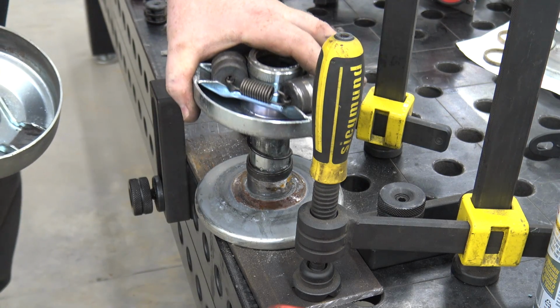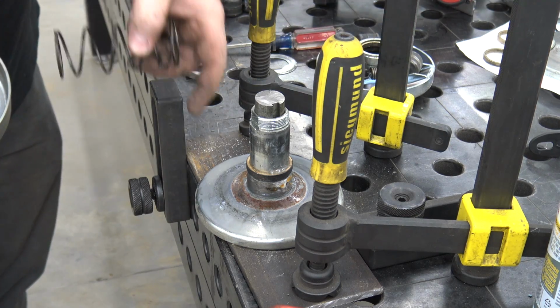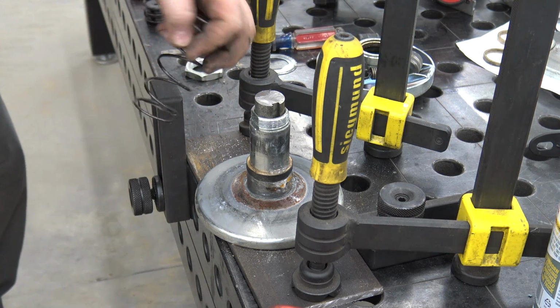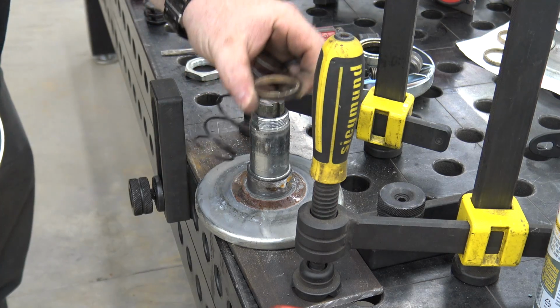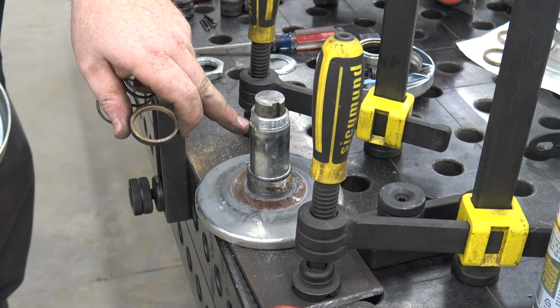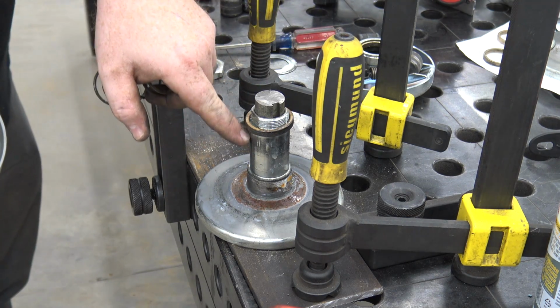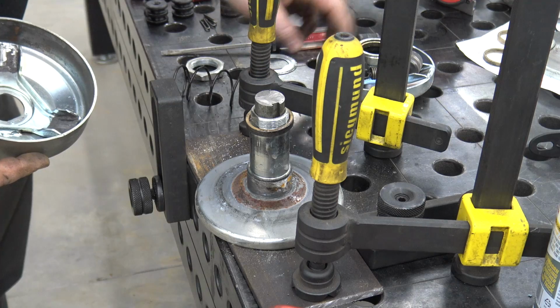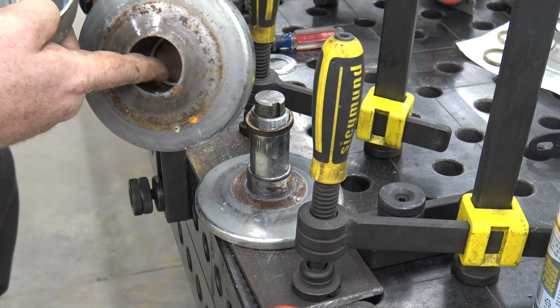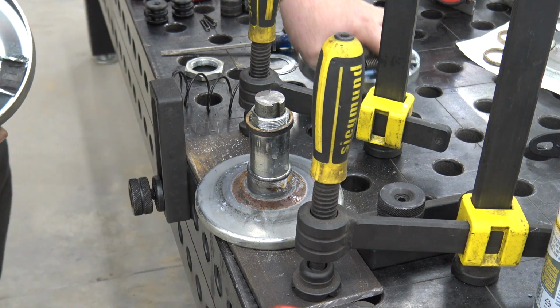It was really seized. What I found is, if you can see, some water was in there from where it rained the other day. But basically, I always polish up these with a wire brush on my little bit driver, and then we're gonna put dry graphite lube on this shaft as well as inside of this, because it looks to have hardly any from factory, so that's going to help lube everything.